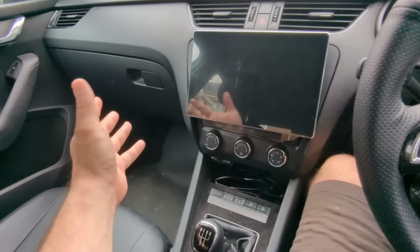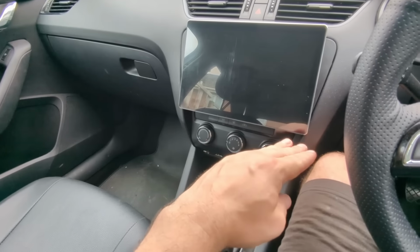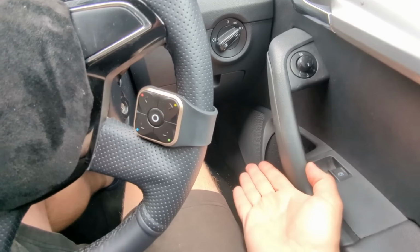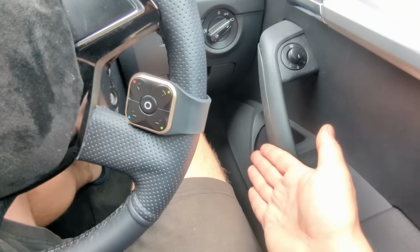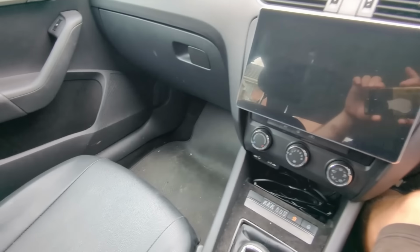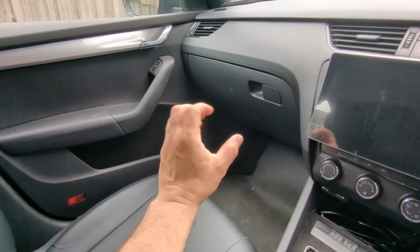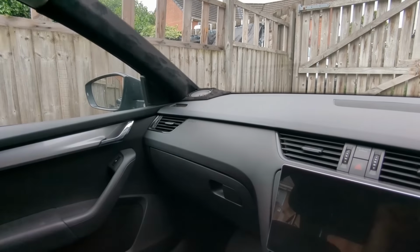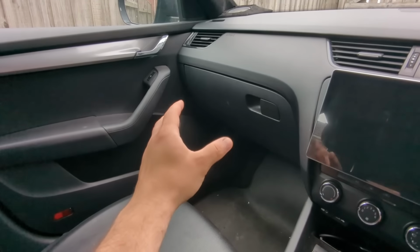So now the question, do I like it and will I keep it? The short answer is obviously no. I do not like that the stage is very low. I do not like that I lost a lot of level. Probably I could bring the level up, increasing the channel gain or the amplifier gain, but then probably I will be risking damaging the tweeters because they are on passive crossover, just one cap, 6 dB slope. So there is a potential for that. And having coax in the front doors, I would not advise it unless you literally have, even if you have like tiny skinny pillars, you can, I don't know, just put a little tweeter somewhere, literally anywhere. Coax in the front door is a big, big no-no.